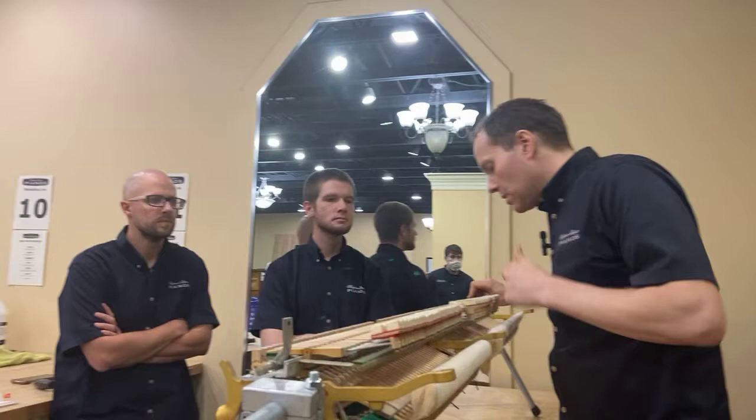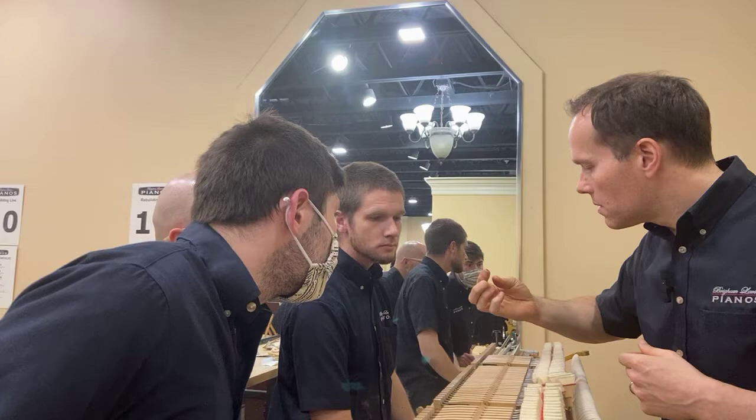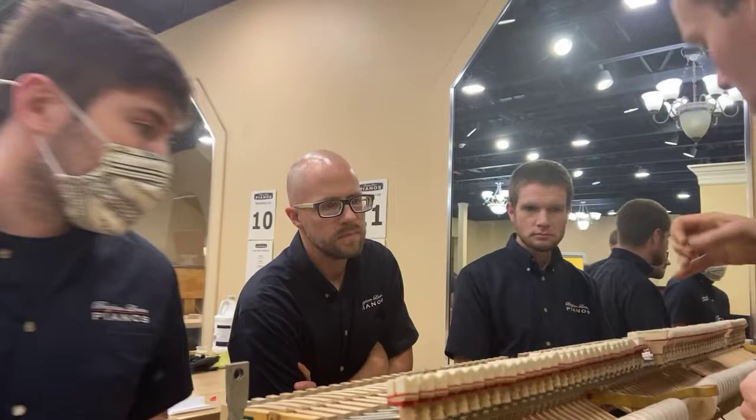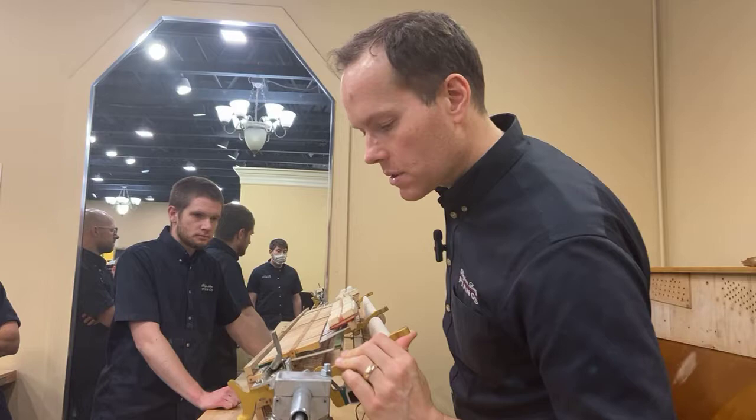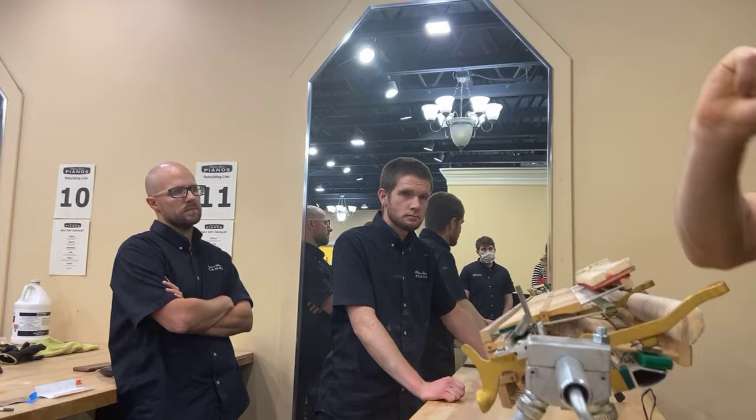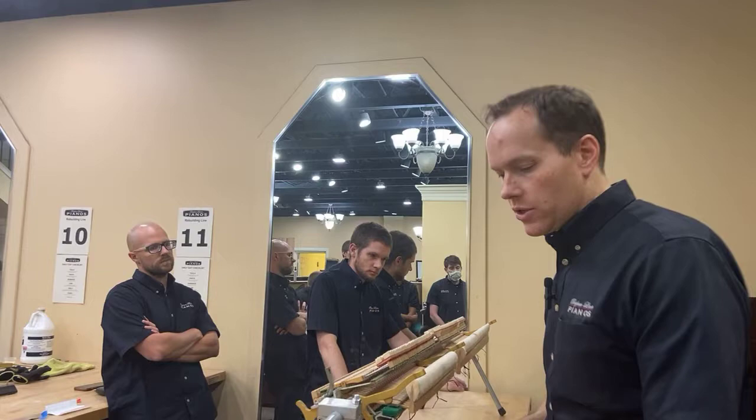is this little hanger. It looks like there's kind of a greasy lubricant on there, but it's old. I can feel it in there. Okay, so there's a little bushing in that little slot. What this pivots on, if you can't see it, is a little hook like that. And inside that hole there, it's bushed by felt, and so we're going to saturate that really well with Protec.